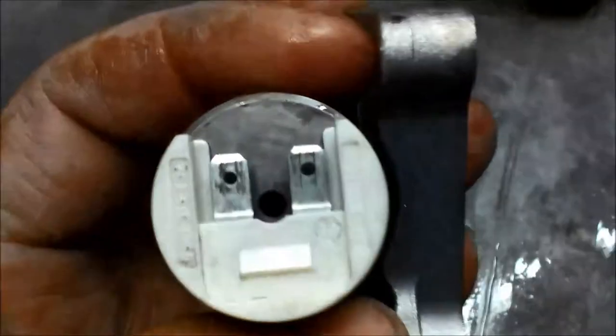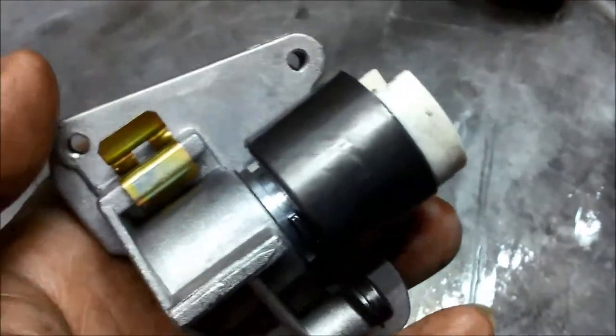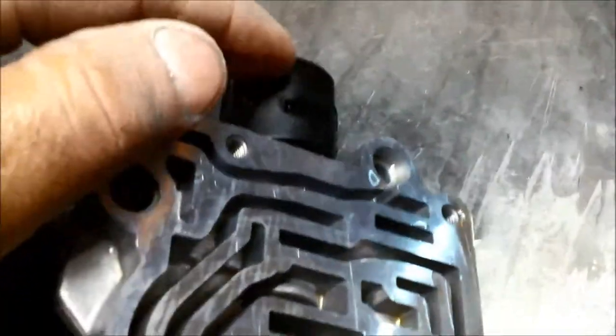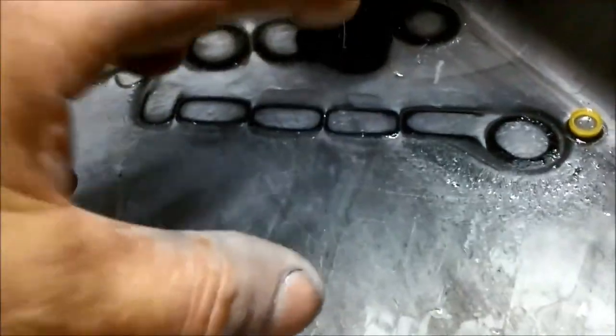Now, thoroughly washed and tested, this solenoid's the lockup for the lockup converter. How much rubbish has come out of that solenoid on its own? Now, I'm just going through slowly and going one by one. I've done this solenoid here and tested it. I'm cleaning the tray each time I do it, and you can see how much rubbish is coming out of those solenoids.